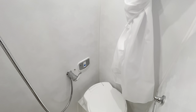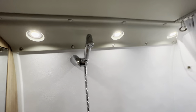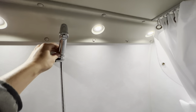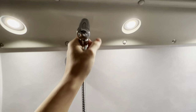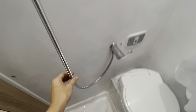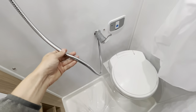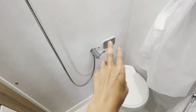In the washroom you've got your shower curtain, which comes around the toilet to stop it from getting wet. When winterising, it's very important to unclip the shower head from the hose, as water can coil up in there and freeze in winter. If you unscrew it, lay it in the shower tray and leave the shower mixer tap open.